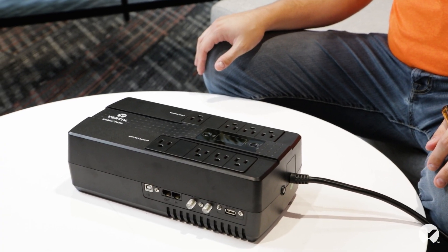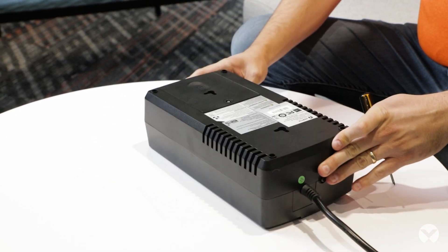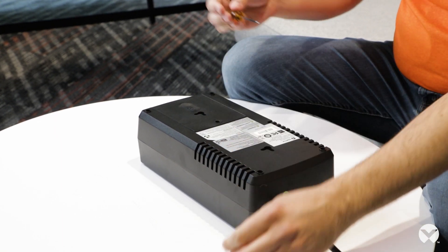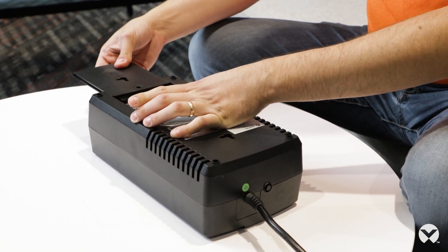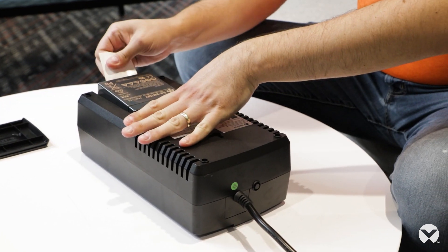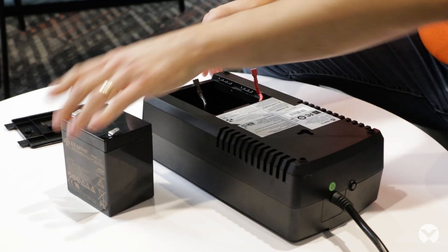Replacing the battery in the PST5 family is extremely easy. The first thing you want to do is make sure that your unit is unplugged. To replace the battery, you turn the unit over to the back side and, using a Phillips screwdriver, you undo the screw holding the battery in. Set this aside, then slide off the back cover using the direction provided by the open arrow. Set aside the cover and, using the handy tab, pull the battery up vertically. Now your battery is removed.